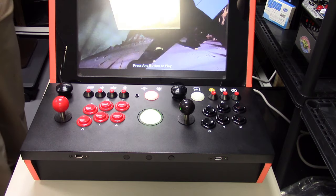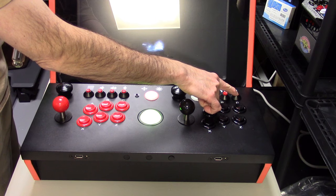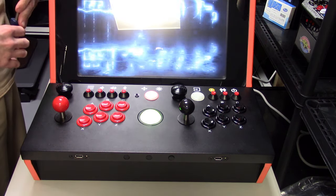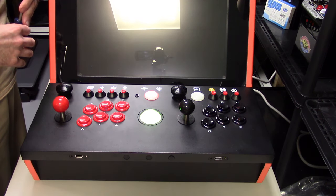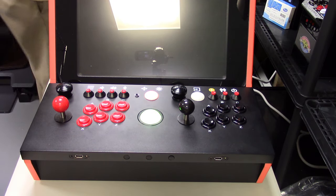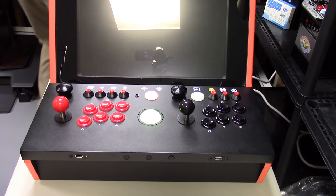Okay, so we have here the GRS Ultimate Control Panel, and obviously the iiRcade is currently powered on. The first thing we want to make sure is we turn it off, make sure it's completely powered off, and also disconnect all AC power from the back just to make sure that there's no current power going to any one of the boards and risk any electrical shock. You should also touch something metal before you touch anything just to make sure you have no static electricity buildup, especially in the winter months. It's a little drier and you don't want to take a chance of shorting anything out.